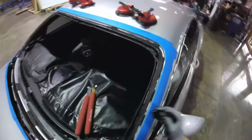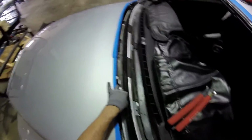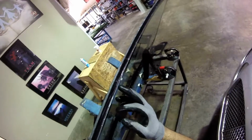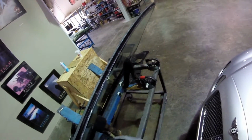Okay guys, so it's time to clean the vehicle, so I'm going to cut the video because my camera is not really good today. I didn't charge it for the last 2 days. So I'm going to cut the primer. Now this one, remember we're going to do the same like regular windshields. We're going to just buff with the F1, then primer, let 6 minutes to dry. We're going to put the glue on.